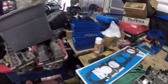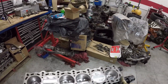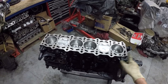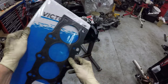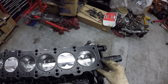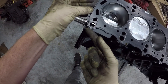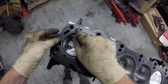First things first — I'm going to set the gasket. As you can see, I've already put the dowel pins in. Those had to be taken out to do the machining of the block. Now these gaskets can be mixed up pretty easily. If you put it on this way, those holes all appear to line up — except for that one. See that? That one doesn't line up.